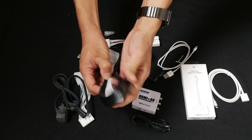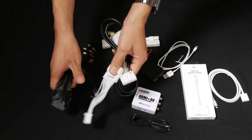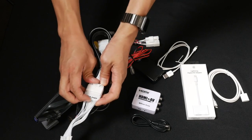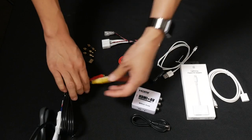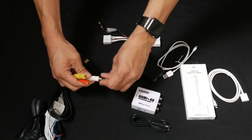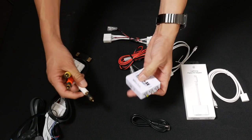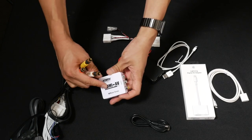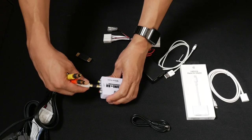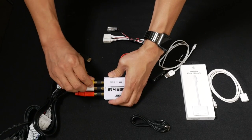As you can see, the connector on this video input piece and the DVD and navigation and motion piece is identical, so you can connect them together ahead of time. The other end of the RCA cable is going to connect to this male-to-male joint connector, which is going to be connected to the HDMI to AV adapter. Double check to make sure the color codes match: white-to-white, red-to-red, and yellow-to-yellow.